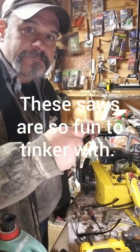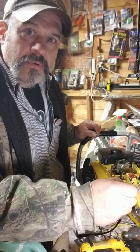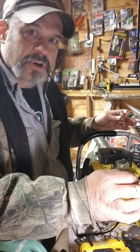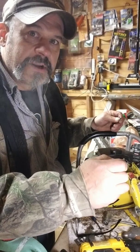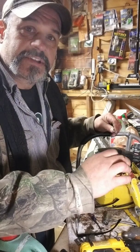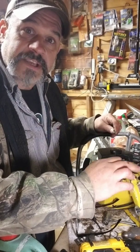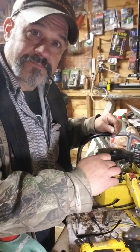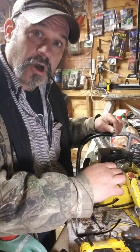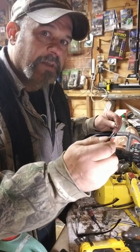The reason I'm doing it is because a saw runs different with an air filter on it. When you have the air filter off, it's getting unobstructed air. So when you adjust your carburetor and then put your air filter back on and your top cover back on, a lot of times you'll notice that it will idle lower, right? Because it's getting less air to the system, so it's running richer with the filter on than it is with everything off. By doing this, I won't have to take that top cover off.